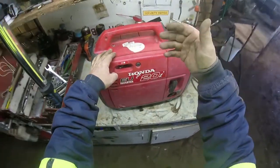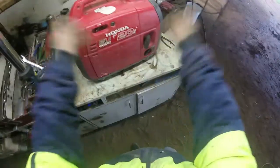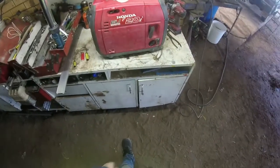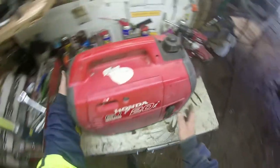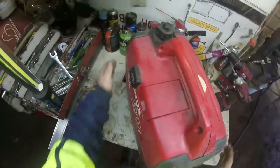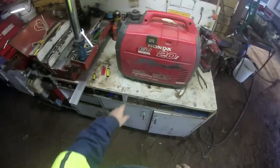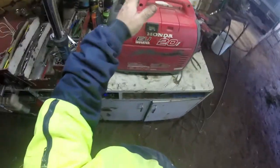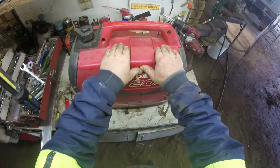You're not turning it off and waiting for the fuel to drain from your carburetor. You don't have to pull that cover off. You just drain it out, suck it dry. So that's a bonus, putting that little switch in. The little hour meter, I purchased this off eBay. I don't think they're that dear, $15 to $30. And they're so simple to set up.